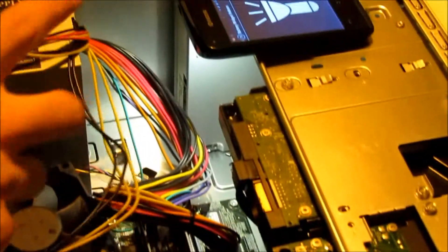Once you've done that, you're going to want to sort out your cables. The first one you should plug in is the main 24-pin power supply connector — that one just goes in there. It might take a little bit of force; sometimes you'll hear a click. Then also there's a 4-pin power connector that goes in usually over on this side. Don't want to forget that — you'll burn out your computer.